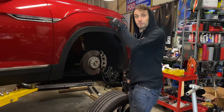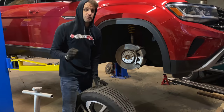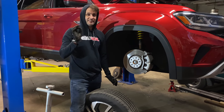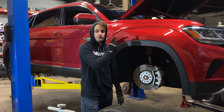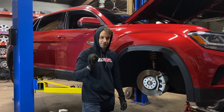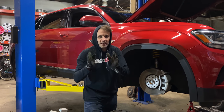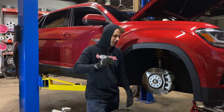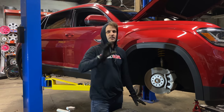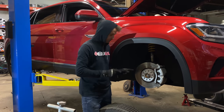The three bolts up top — we still have to torque those. They're hand tight right now, but be very careful tightening those. The torque setting I will put in the comments below. You can strip those threads, and if you do they're a pain to fix. On the OEM housings the nut underneath is a captive nut, and too much torque will bust it and you're going to have to fight it out. Get a torque wrench — cheap or nice, doesn't matter — just get one and use it on these bolts.